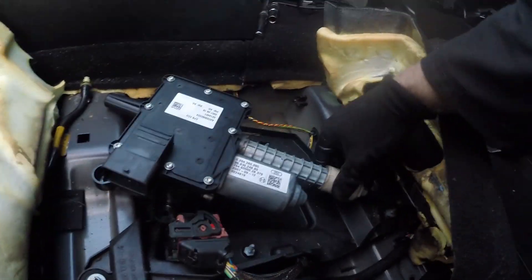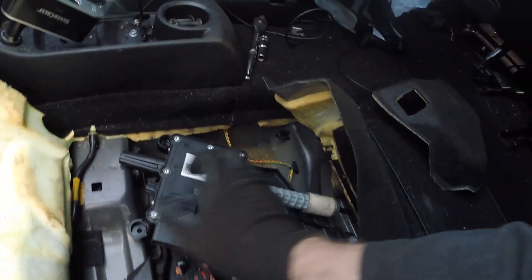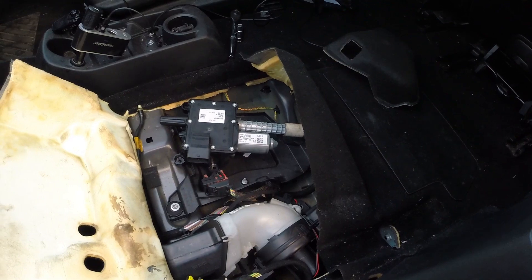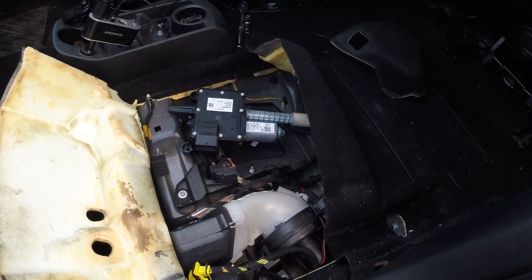I'll show you a little something on the actuator with the old cable. You've got this nipple and it hooks onto the actuator, then you've got two tabs you've got to line up, push it all in, and screw it in. I found it easy to actually take the actuator out — it's only four 10mm nuts holding it in. I managed to get it connected, so I'll just point that out in case you're doing this job. Just got to button it all up and then everything's done.